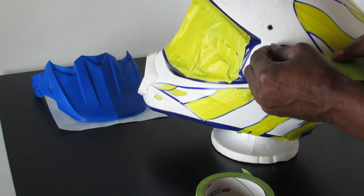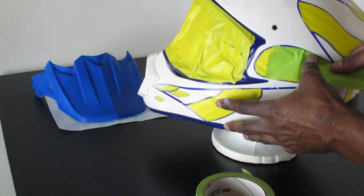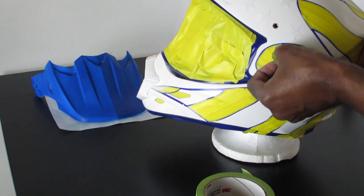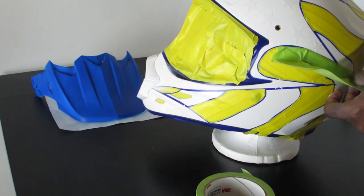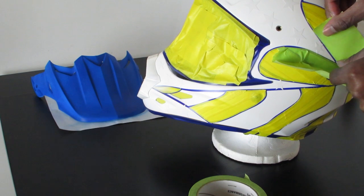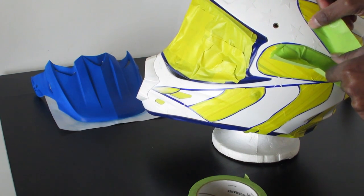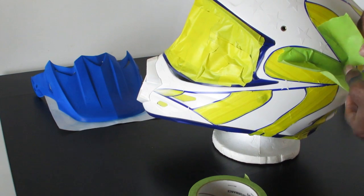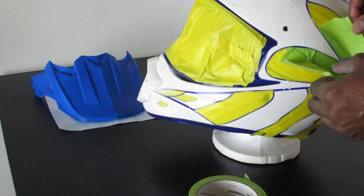For this next part we need to create a shield as a mask, for two different reasons. The first reason is speed, and the second is to protect the area that's going to have stripes — that area will have red and we don't want the red and blue mixing and making purple. So you take the areas you don't want paint to hit, fold them up right against the blue fine line tape, creating a shield so that when overspray hits that area it lifts up and doesn't go over the tape into areas you don't want painted.